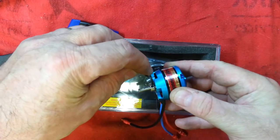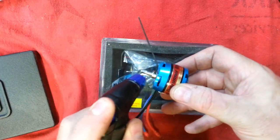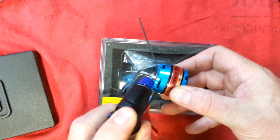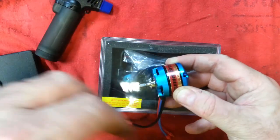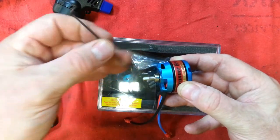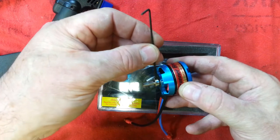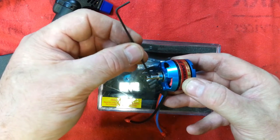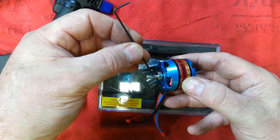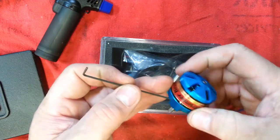That's probably enough. I'm going to put the wrench in. It needs a little more. There we go — didn't take very much force at all. An important clue: don't touch the tip of the wrench there, it's hot. There's a notch in the shaft, so I have to turn the set screw out a few turns. If I just crack it loose and then try to push the wheel collar off, the tip of the screw will gouge the shaft and damage it. So we want to be careful of that — I have it almost completely out, but it's still in there enough that it won't fall out.